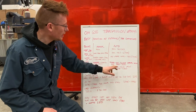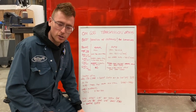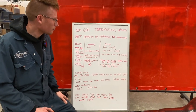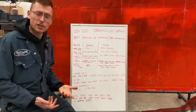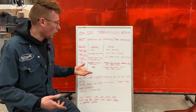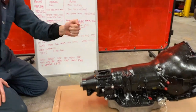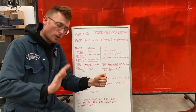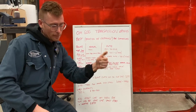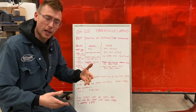You can have that power where you want it. You're going to want a stall speed of 3,000 to 3,500 for a 500 horsepower, 606 single-turbo application. That'll make it really nice and drivable — it'll keep it on boost when you want it. If you've got trans-brake — a little module on the side — you can lock up the transmission at the lights, put your foot flat to the floor, build up your boost, and when that light goes green you let go and your car's off. That's a nice option for building boost at the line.